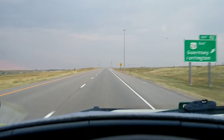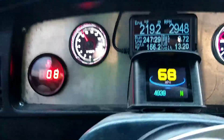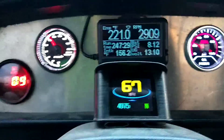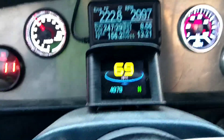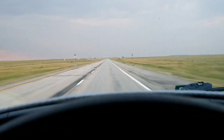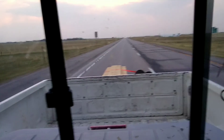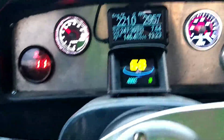Got a little bit of a break and then a big climb. We're almost to crest the hill here — just about to hit 220 degrees, I'm up to 1,100 degree EGTs, and we are almost to 5,000 feet. And we're up. I've been letting off a little slowly here just to ease up on it, but I'm still almost at 70. Now we're on flat again, and that is about the worst stretch I could put it through. We should start seeing the coolant temp drop back down. And we're dropping temp. Can't beat it.